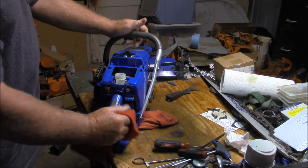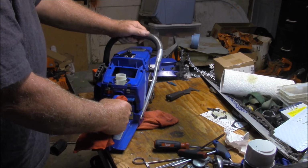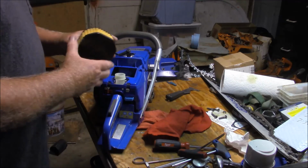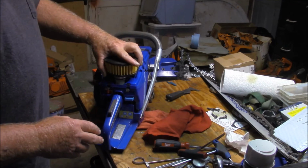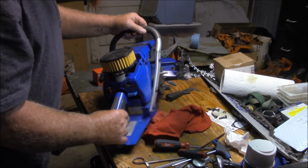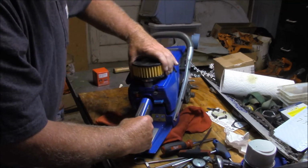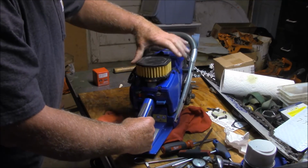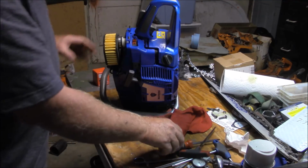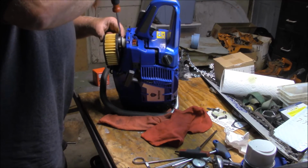So what that tells me is this is a good functioning saw for a person who has the strength to run it. And maybe what I'll do is try to lean it out a little bit in the bottom. But I don't have to go figure out why it's not getting fuel. In fact, it's getting a lot of fuel. The choke is working just fine, so it's nothing related to that. It is more related to my arm strength and how much speed I can get that saw to spin over at when I pull on it. I'd say that's probably the biggest problem I have, is I just can't generate the snap anymore.